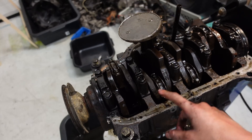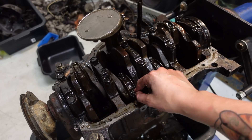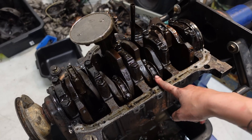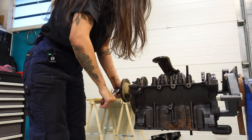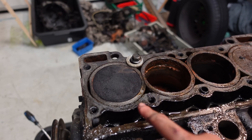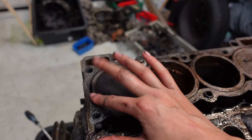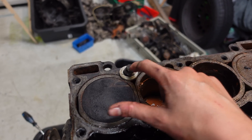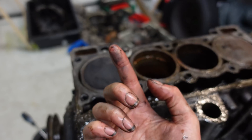I'm going to turn the engine a bit so these pistons are on the top, and then I'm going to release these bolts and we can take the pistons out. I almost forgot — I don't want these things to get out. I don't know what you call them in English, but I'm using a bolt and this ring to keep them in place when I'm tapping the piston from the other side.